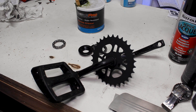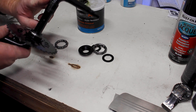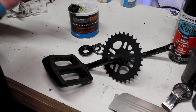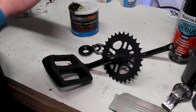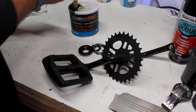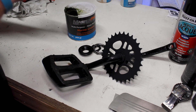Really all we're going to grease is our bearings and then the threads on the actual crank set — these threads where your adjuster and lock nut are going to go on. I like using a brush here; it helps you get nice and deep into all the cracks. We're going to grease one side up and then try and jam some grease around the backside of the bearings as well.